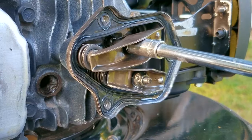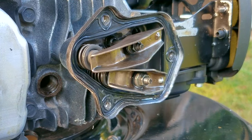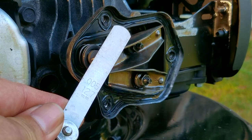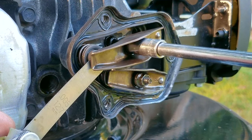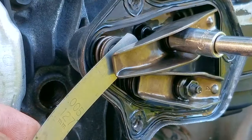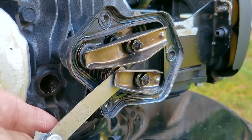For this model, all you have to do is turn the nuts to adjust them — first we'll start by making them loose. I'll then get out the five-thousandths-of-an-inch feeler gauge and slip it under the loose rocker arm. Once under it, I'll start to turn the nut to tighten it and at the same time try to keep the feeler gauge moving so I can tell when it starts to get stuck under the arm. We want to make the clearance just large enough so that the feeler gauge just drags between the valve and the rocker arm. After that, I'll rotate the engine again so the other rocker arm will be loose and do the same process there.